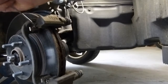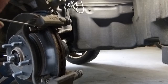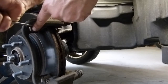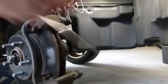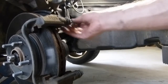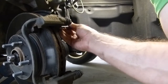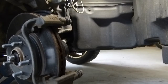The next thing I'll do is remove these old pad clips. The easiest thing to do is use a small screwdriver and go in on the outer side of the caliper bracket between the bracket and the clip, work it in, and then roll it out. The spring tension on it will kind of make it fly, so you may want to be careful. I'll do the inner ones the same way. So those four clips are out of the way and set aside.